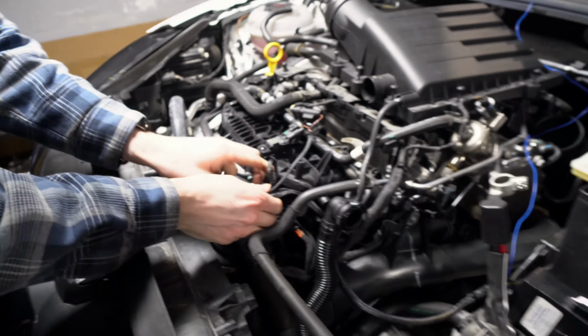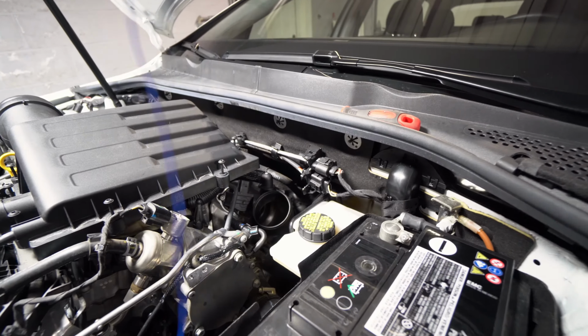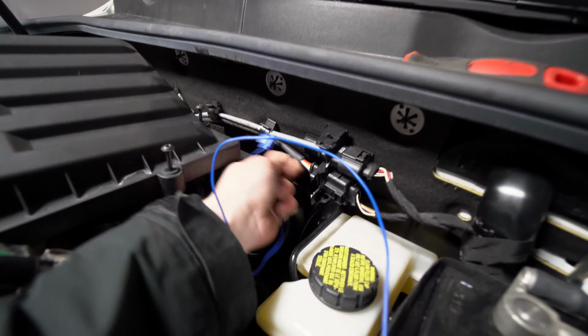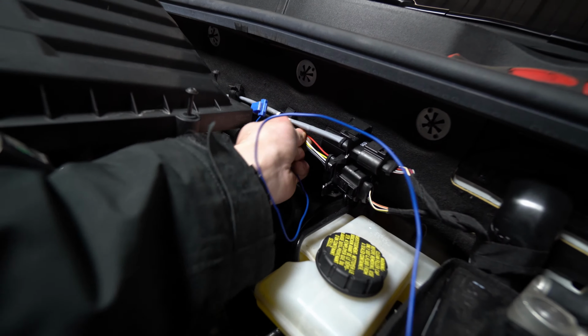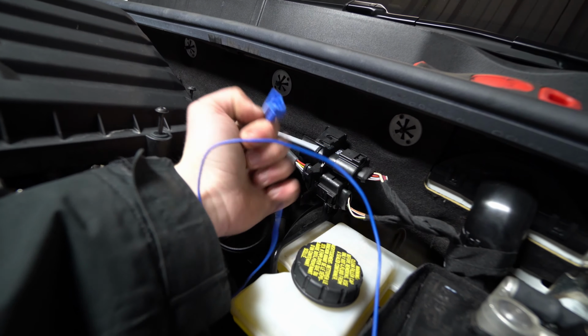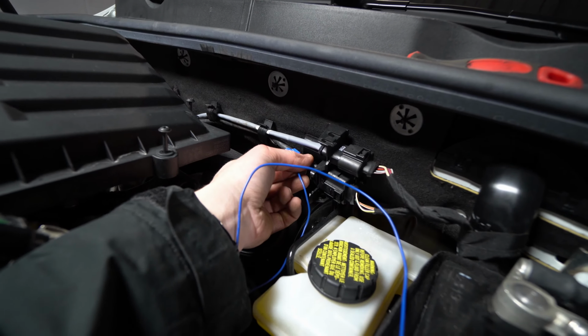So now that we got all the plugs connected, what we do is get the O2 sensor wire on, and we wanna connect to this red one, so we pull the sleeve back a little ways, because if you ever wanna be stealthy, you can hide where you vampire clipped it back into there. So we'll get this guy on the red wire.